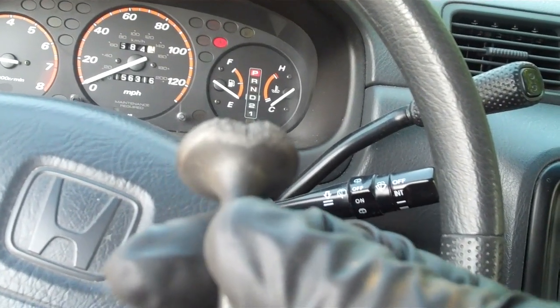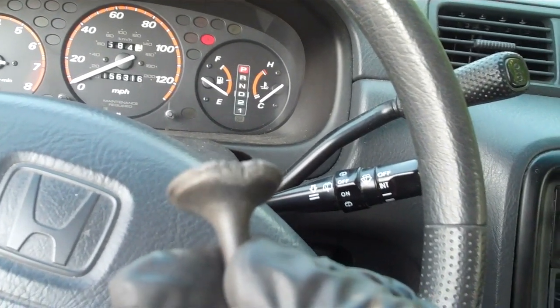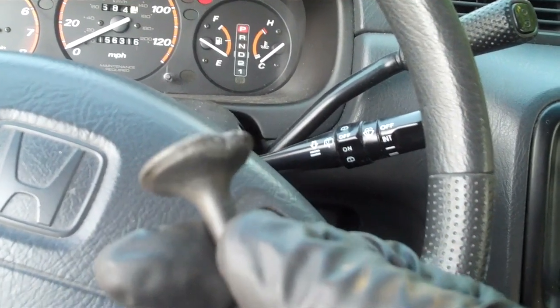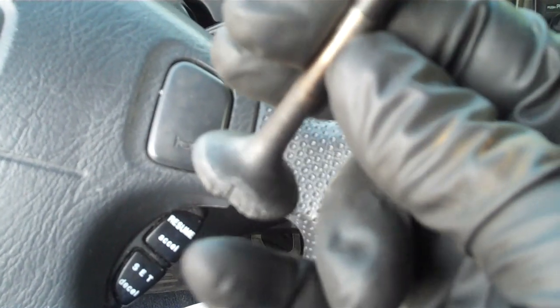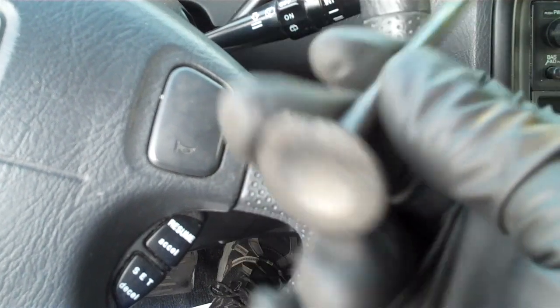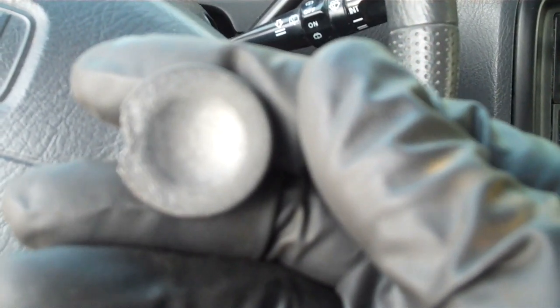Look at the burn on that thing — it looks like it just got old and cracked up and oxidized. I guess if the valves don't close all the way, you get the fire going through there, and instead of being one flat good surface that can take the heat, it gets all along this little rim, and being along the rim, it heats up real quick. Maybe I'll do a demo with the torch and show you what I'm talking about.